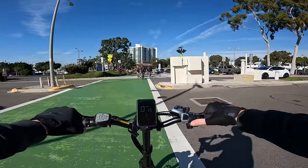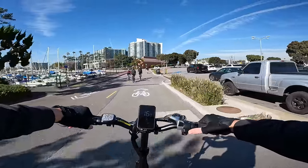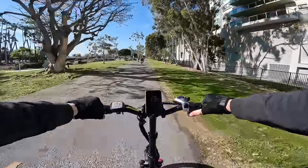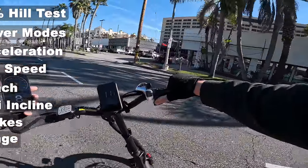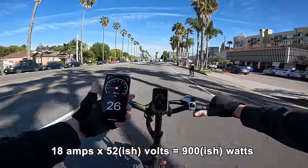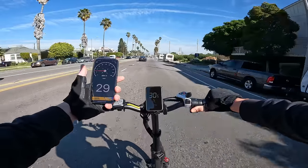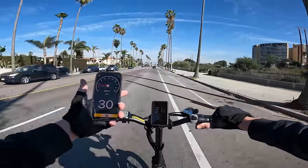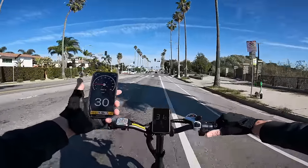To talk about the benefit of that lower power draw: you really get to choose speed or range on an e-bike. This one draws less power and has a huge battery, so I think we're going to do really well on range. I had the suspension locked — no wonder it felt harsher than expected. Let's see what high speed we can hit. The GPS is accurate; let's see if the onboard is accurate. We're pulling 15-18 amps of current, showing 27-28 on GPS and 29-30 on the onboard display — even hitting 31.5 on board, 30 on GPS. Not too shabby. This will hurt our range if we keep doing this — let's stop.